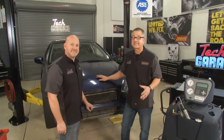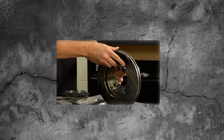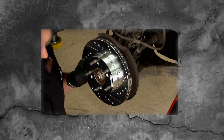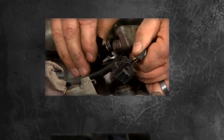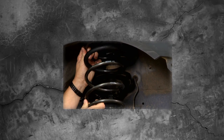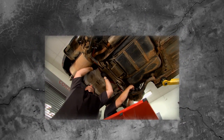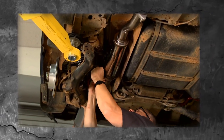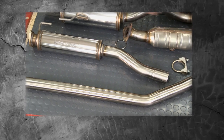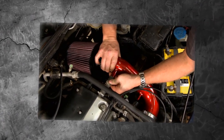RSX Resurrection is back in the shop, and it's come a long way. We started with brake horsepower — drilled and slotted rotors with new pads. Then old-school power upgrades: fuel injectors flowing more fuel and dispensing it in the right spray pattern. We went after the suspension with Eibach springs to lower it and Monroe struts all the way around all four corners. Then a cold air intake, a header, and a full exhaust system back — flowing a lot more air in, better fuel dispensation, and more air out.